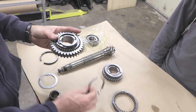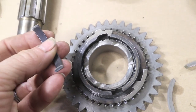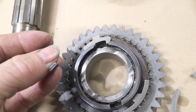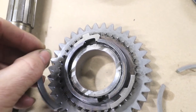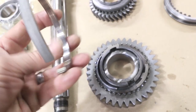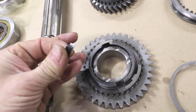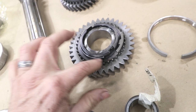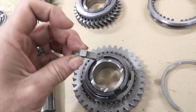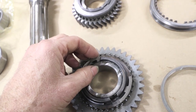I'm going to go ahead and put the new synchro ring in — this is the brand new part. Just like everything else, I've inspected these parts for wear and I've taken off any sharp burrs on the end of these things. You don't want your band to get hung up on either the dog teeth or the inside of the synchro ring. These are sliding pieces so you don't want any sharp edges catching within the gear assembly. Everything's in good shape — no major wear on these blocks, just a few shiny spots, which is normal.